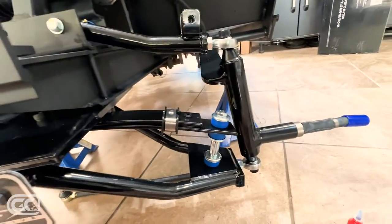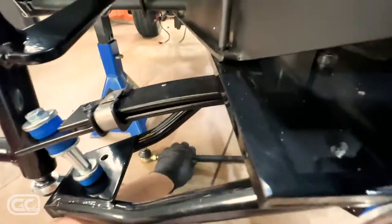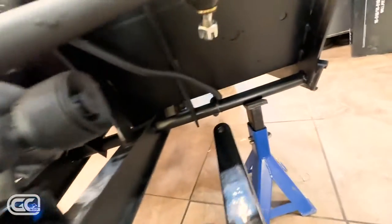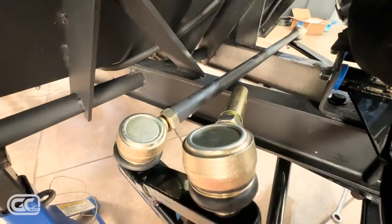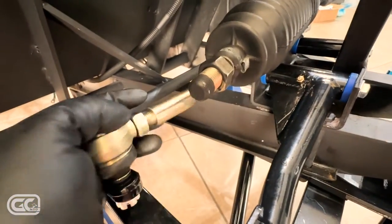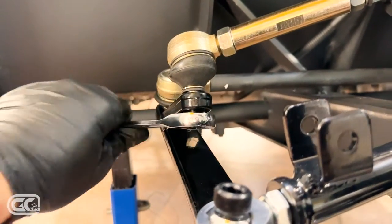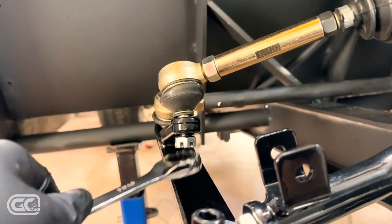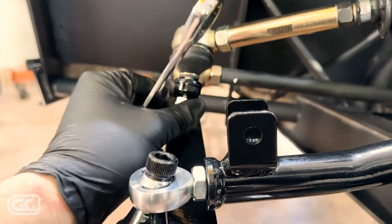Everything is snugged up on the kit — I've kept all my little protective sleeves on the spindles so dirt doesn't grind up the bearings. I've put new tie rod ends on my tie rod and I'm setting them in — one there and one there on each hole. The steering connection goes right here. All castle nuts on this link are 11/16ths. This link does articulate up and down and left and right, so you can get it to set the way you want since the geometry is angular — it's not going to be a straight fit.